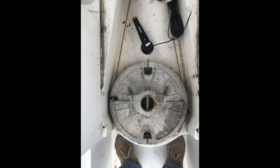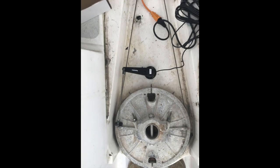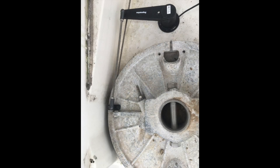The other end of the connecting rod has to connect to the steering quadrant. In the kit is a little knob that serves as the connector. In my case, when screwing this to the steering quadrant, I had to be careful to shorten the screws just a little bit so they didn't interfere with the steering cables connected to the steering quadrant.